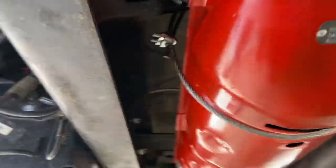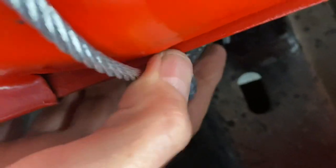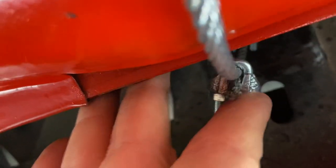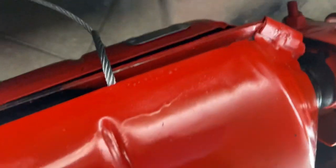Let me show you what I did. I've got three separate wraps of cables. It wasn't especially easy, but I worked the cabling through the sheet metal of the heat shielding on the catalytic converter, then went up and found a hole in the frame, brought it back down, and put on two of these clamps that came with the kit — six total. One clamp is probably enough. The nuts are five-sixteenths for the socket or wrench you'll use to tighten them. I added one to the back side of the catalytic converter, going through, up and around. This heat shielding is welded, so it's going to be hard for someone to just yank it off.